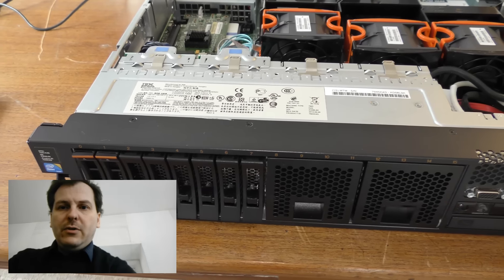Hi and welcome to my playhouse. Today I want to show how simple it is to take a Lenovo X3650 Model 3 and replace the entry-level RAID controller with a better one. For this specific task I have the LSI RAID controller which Lenovo calls M5015 — a really nice RAID controller. We're going to pop that RAID controller in, and maybe in the next video I'll work on expanding this server to obtain more than the eight drives it comes with standard.